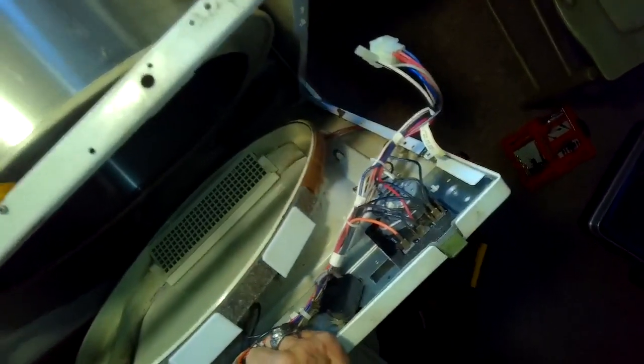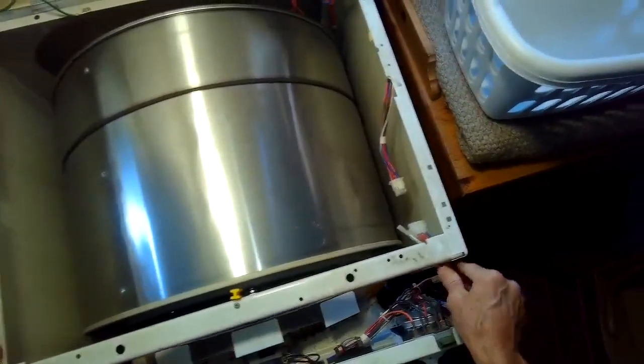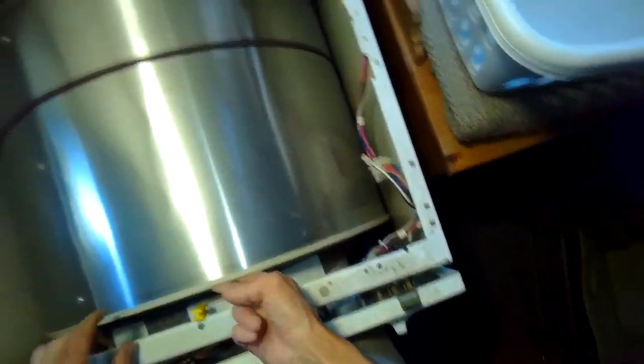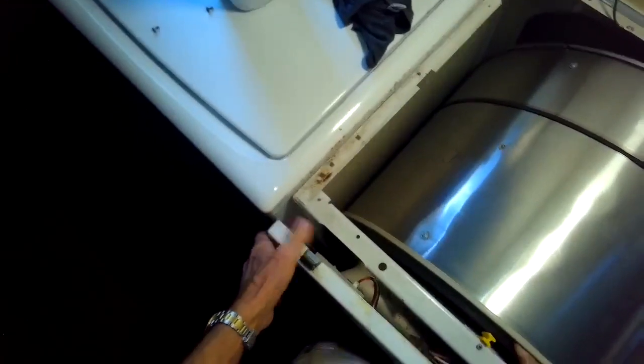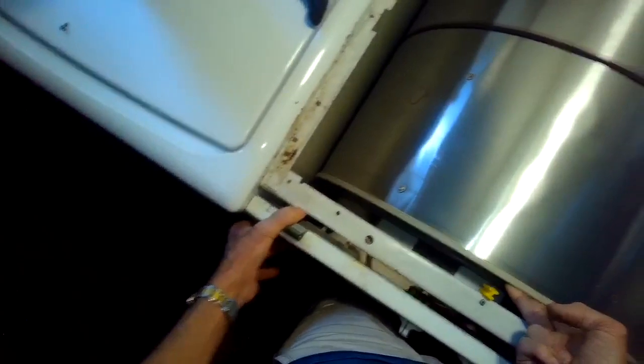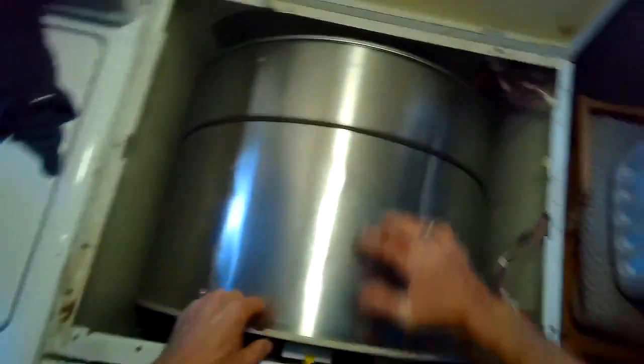This will cure the problem of a squeaky dryer and also a dryer that's burning holes in clothing — though squeakiness could also be from the rear bearing wearing out. To put the front panel back on, set it down on the two little clips in the front, then tilt it in toward the back of the dryer. Feed the modular connector back through and lift up on the tumbler a little bit so it can ride back up on the new front bearing. Be careful that as you push the panel on, it doesn't shove the new bearing away from you.